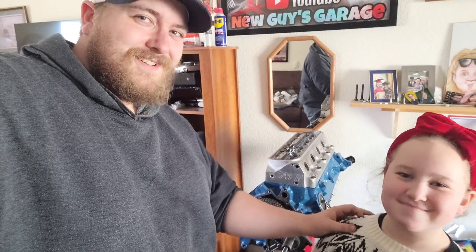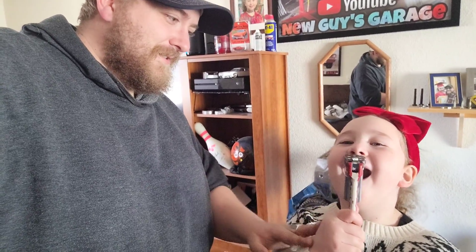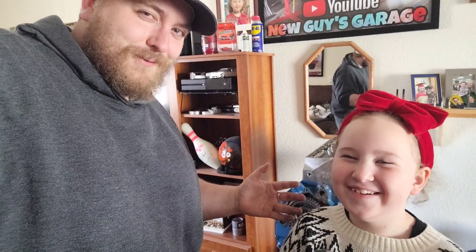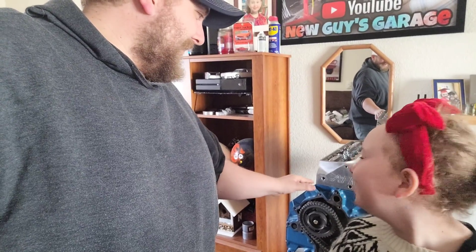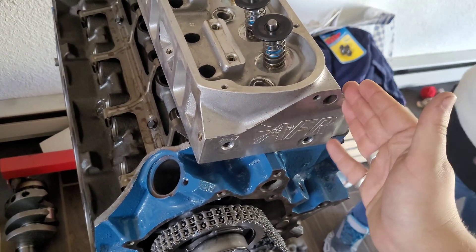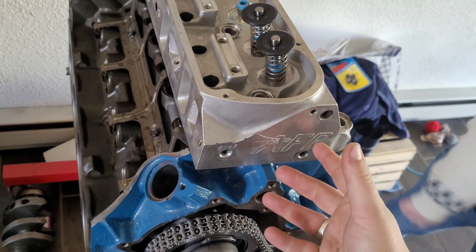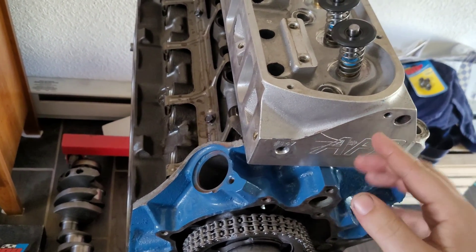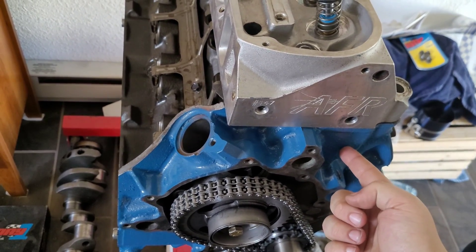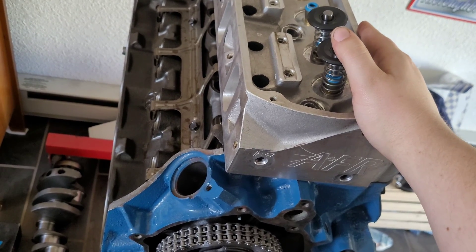This has been the bane of my existence for a long time - trying to figure out a head-piston combination. We have stock TRW 302 pistons. These are AFR Renegade 165cc cylinder heads - at least they were 165s. There's been some porting and bigger 202 intake diameter valves put in these heads. They're kind of a trick unit, and that's the big problem because we have stock 302 pistons with the dinky valve reliefs.